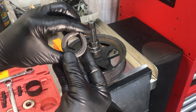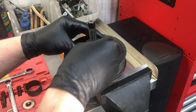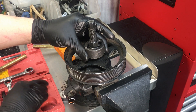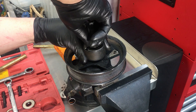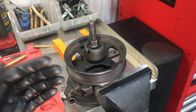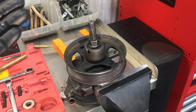We're going to use the side of the collars that has the smaller inside diameter — not the big side. Make sure the collars are seated in the groove on both sides, just like so. Then put the sleeve over it, and while holding that whole contraption, loosen this part right here. That'll bring it up and pull tension on the collars to keep them in place while we pull the pulley off. At this point it's ready to press off — simply turn it counterclockwise and it will force the pulley off the shaft.